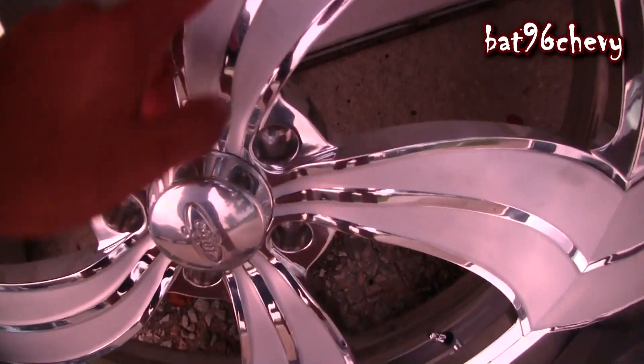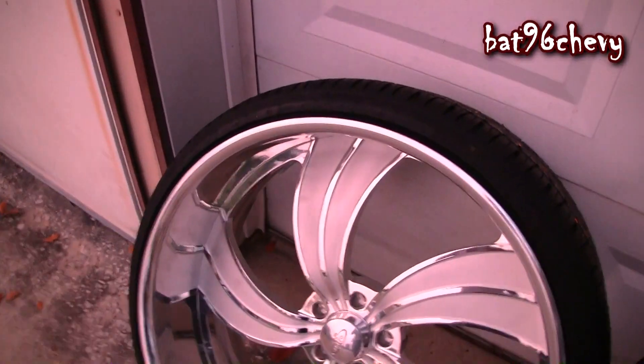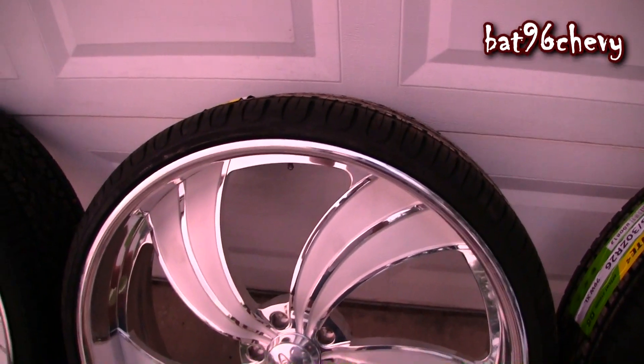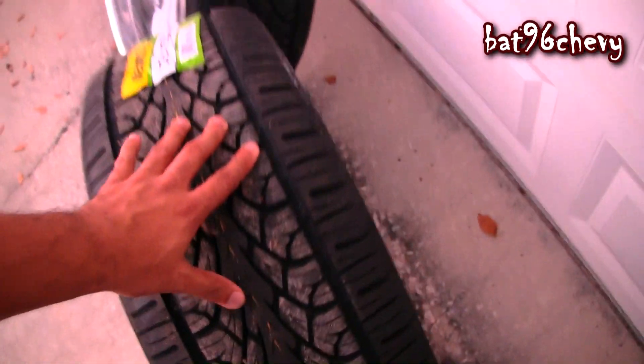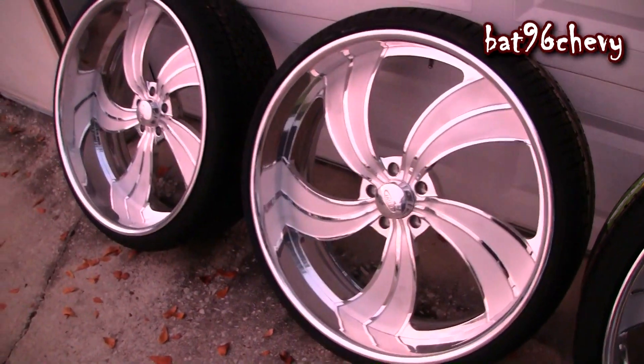Got these nice grooves in there, I freaking love it. The wheels are almost a whitish color — they call this finish 'satin suede,' that's what Intro calls it. It looks almost white but it's real fresh looking. I got 255/30s for the back so I can have some meat on the tires since I drive my car, and 275/25 for the front to keep the car low. The 275/25 looks pretty good stretched on a 9-inch wide wheel. Can't wait to get them mounted on the car.